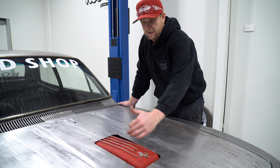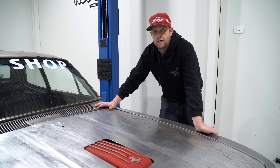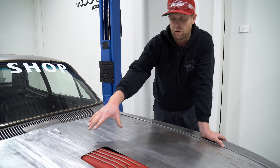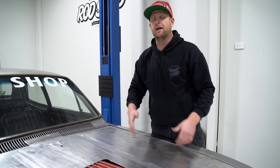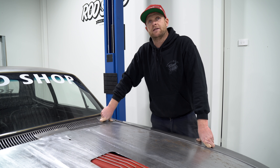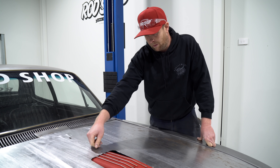We've taken 10mm either side, 10mm off the back, and 5mm off the front. I'm pretty happy with the front and the two sides. The back is a bit of a pain — it's not that simple to work out that cut off a measurement. The issue is the engine tapers back with the driveline angle and that rocker cover runs downhill. Also the bonnet is going forward and it's got a bulge. If everything was pretty square we could just find a datum line at the front, measure back, run a string line across the top of the guards and we'd have our cut. I think I'm just going to have to go 10mm at a time — I'm thinking 30mm total.